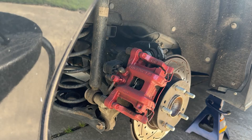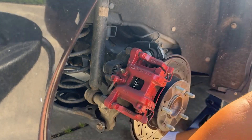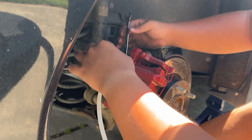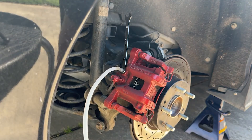Now it's the passenger rear — same concept. Here's the brake fluid cap, just tip that off, get your bleeder and put it on nice and snug. That should be enough. You can see the fluid coming out — let's go ahead and bleed these brakes as well.